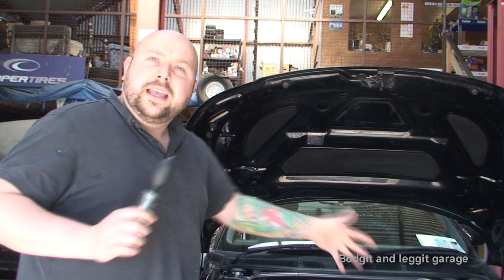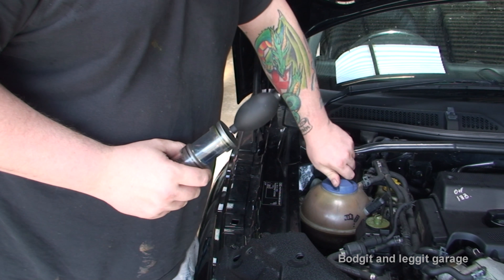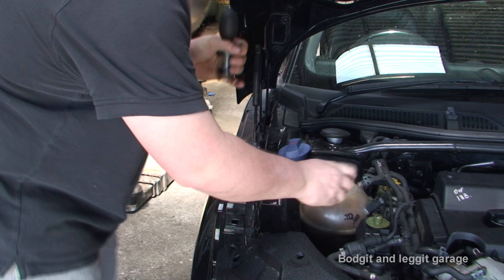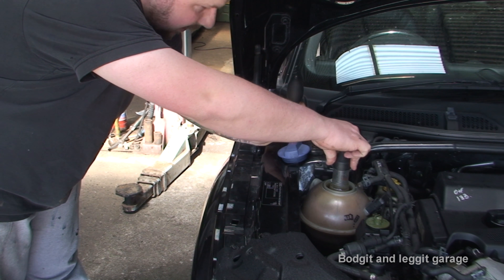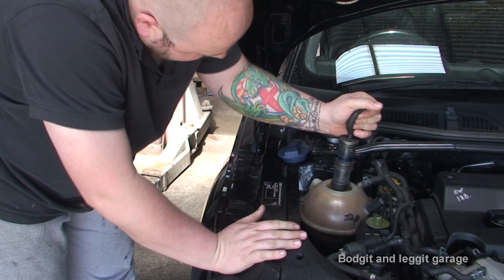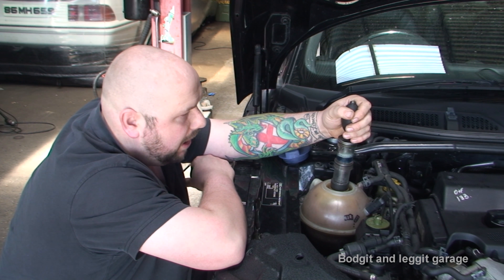The way to do it is get the car heated up. We're looking for steam to come out of here. When you take the cap off, I like to fill the chamber completely. See that steam there? The steam's coming up through there and it's going to fill this chamber. If this turns green, we have a head gasket leak. If it stays blue, we're okay.